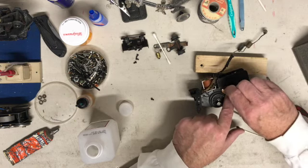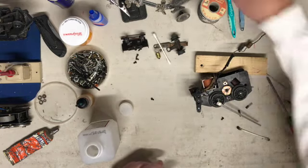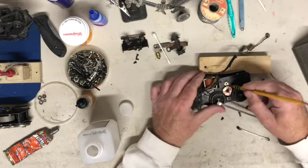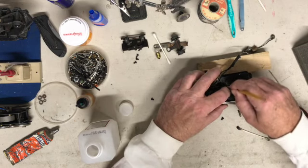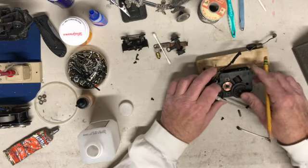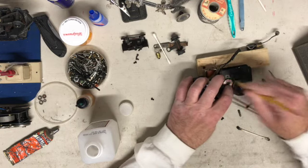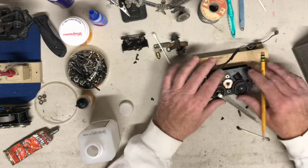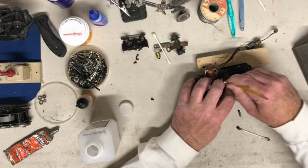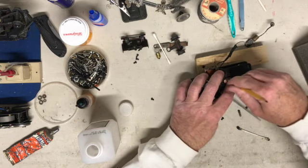Just dig out. You don't want anything too sharp or too deep to get in there, but what you can also do, I've done this too, sometimes I'll use a pencil eraser and get in here and get the rest of that stuff off. You can see it starts to make it like a shiny new penny, and the rubber doesn't really hurt the commutator. So you don't have to push with all your might, but just rub it enough to get off that last final deep down stuff.